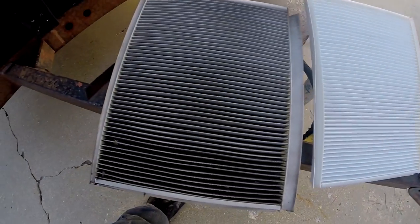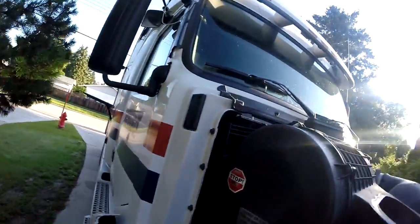I just figured I'd show you the air filter for the air intake for the cab — the fan inside that always blows the air conditioning and heating. Just going to change that and have a look at how dirty it is. That's a brand new one and that's the one that was in there, so that just goes to show you how dirty they get. They've got it right up here on the wall — that's where they install them — so that's where we're going to replace it and put the brand new one in. It's also got one in the bunk right underneath the bed.